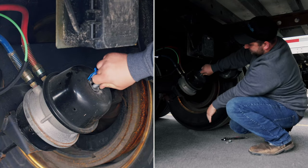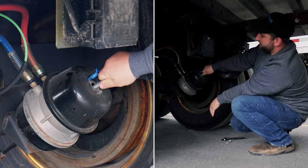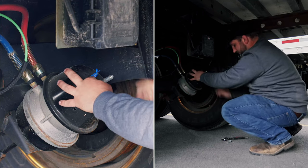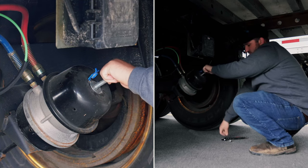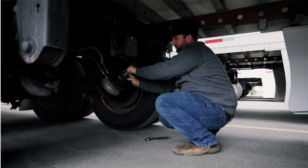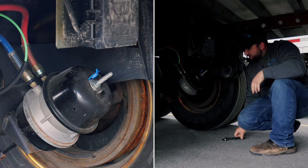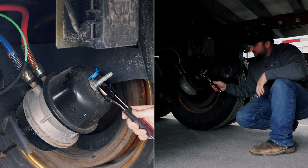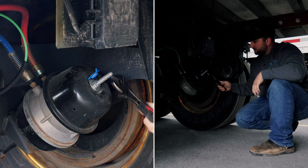Get in there — you're going to push it into the grooves, turn it about 90 degrees, pull it towards you, and make sure it doesn't come out. Put your washer on, then your nut, then cage the brakes. You're going to take your adjustable wrench and tighten up this nut until it stops turning.